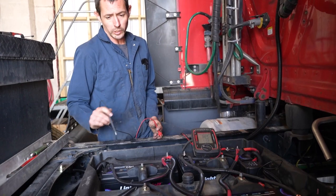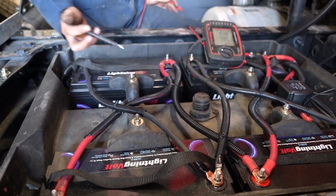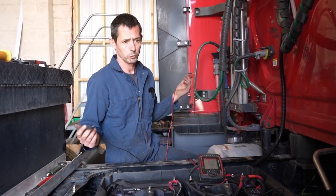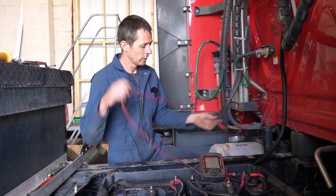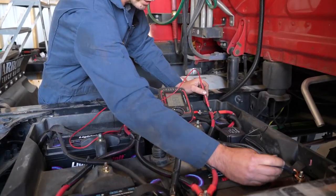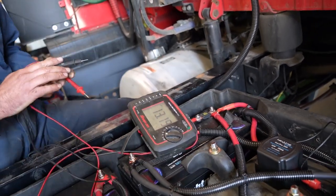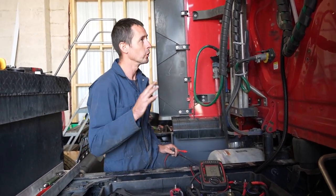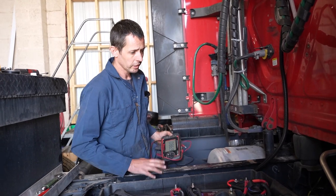We've hooked up all of our batteries here in parallel, which basically means all the positives are connected and all of the negatives are connected, so that way we have 12 volts. These batteries can go up — you can put them in series and get up to 24 or 48 volts if necessary, but for our purposes on a truck, 12 volts is the standard. Just to make sure everything's right before we connect, we always want to confirm we have 12 volts — we're at 13.2, so a little bit higher than normal. These are lithium batteries; this is my first experience with them, a whole new project for us. Let's go ahead and make this connection — I feel good about everything and we'll see if this thing works.